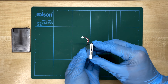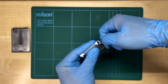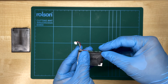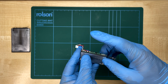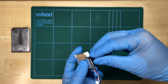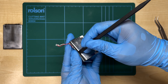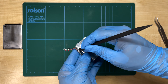On the iPod battery, the terminals are on the side, and sometimes you can just peel them off with your fingers. Now the board on the iPod battery is very fragile — it can flex very easily, and if you bend it too far you'll hear a click and one of the components will probably snap, so be careful. One useful trick is to slide a plastic pry tool underneath the board and gently slide it upwards — that way it doesn't bend the board too much, and it can remove the adhesive underneath, freeing the board itself.